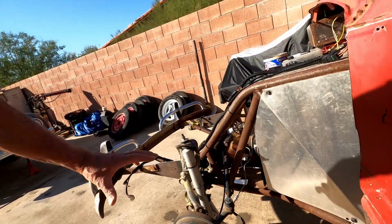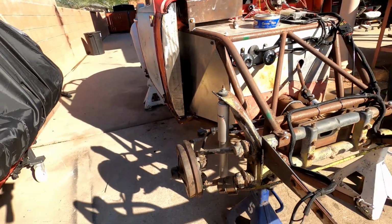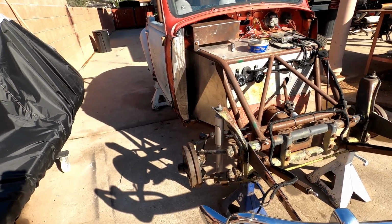When I was out driving around in Rallybug the last few days, it was bothering my mind. I'm like, boy, did I ever tighten up those front hubs? And sure enough, I get over to Safeway and I took the wheel and I could tell it was a little bit loose. I was able to shake it a little bit. And it's like, well, I better make it home and tighten up those hubs. So I got on home and I opened up the little hub caps there, I guess they're called bearing caps, and sure enough, the little Allen screw in there that you tighten up so they don't back up, well, it wasn't even tight. So I went ahead and tightened up the hubs and went out for another rip.